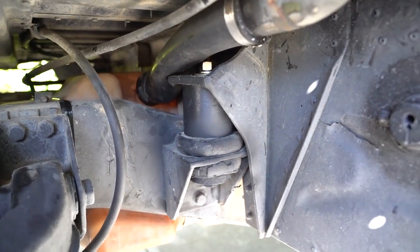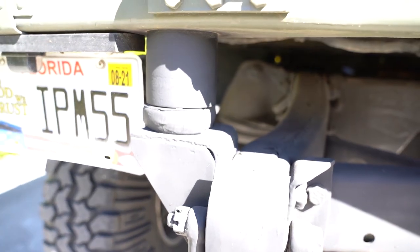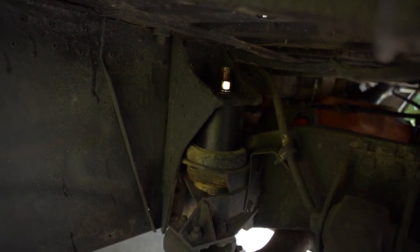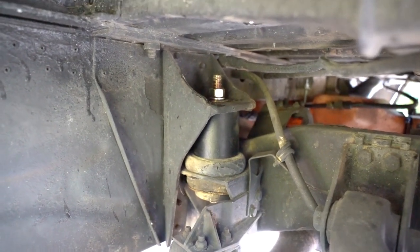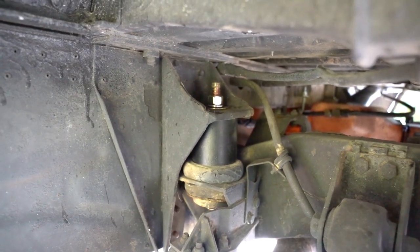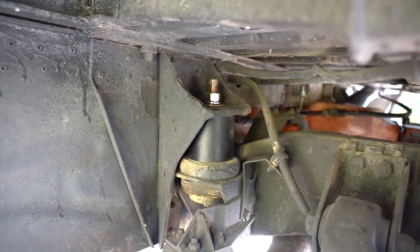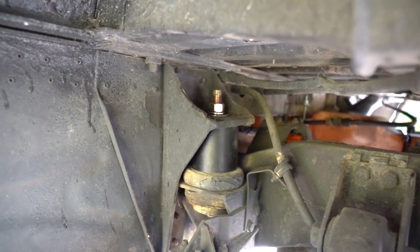These are the 4 rear pucks. The one by the gas filler — easy to get to, easy to do. The one at the rear — easy as well. The others are easy to get to as well. So those are not too hard, just very stiff and take quite a bit of work to break them free. I had some giant breaker bars because my truck wasn't rusted, but they had heavy-duty undercoating on all the threads. It took a lot of muscle to break those free — my impact gun couldn't do it. Big breaker bars and leverage — that's what did it.